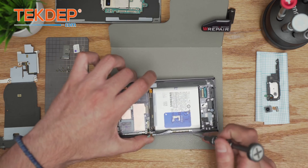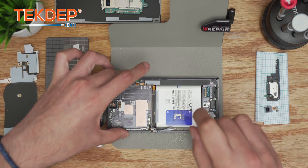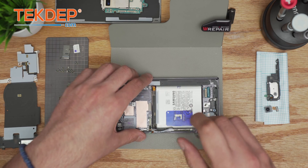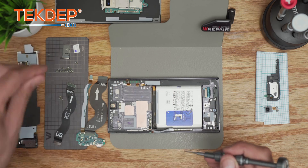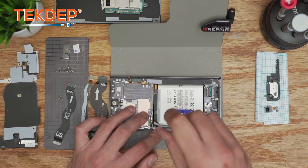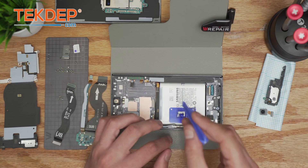This is the antenna module — the motherboard comes out from the top. When it comes to these two little pieces, for the international version they do not exist. For certain countries, 5G is still not perfected yet so it's either embedded in the motherboard or doesn't exist at all. However, only for the United States version will you see those 5G antenna modules. It got me curious why only in the US — if you have an idea, please leave it in the comments.